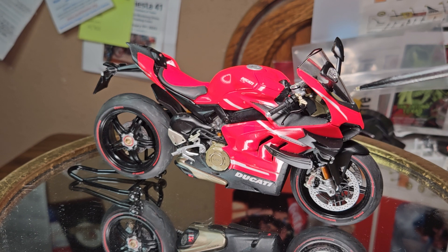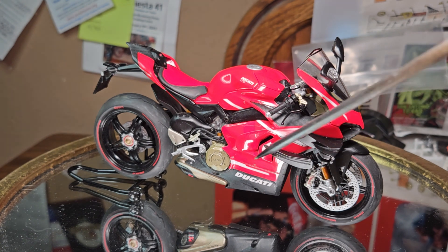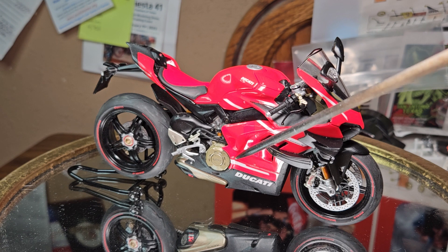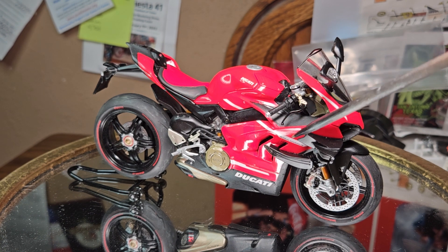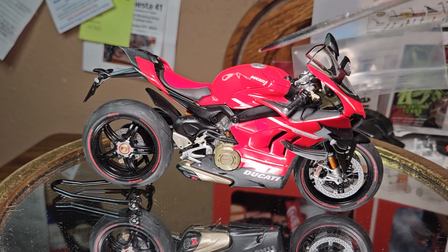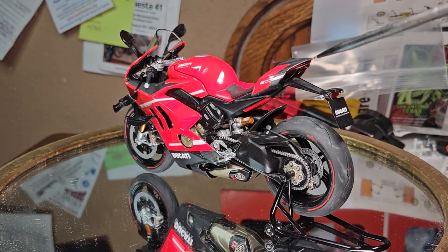I was in kind of a rush. It was a Sunday morning and I was trying to get all the tape laid down so I could get it shot before lunchtime. I forgot to go back and press my tape down where the tape overlapped. This was probably my worst spot — I burned through here — but with a lot of slow, tedious sanding, I got all the parts where I had the flat bleeds underneath the tape sanded out. As you can see, it's been re-polished, waxed.